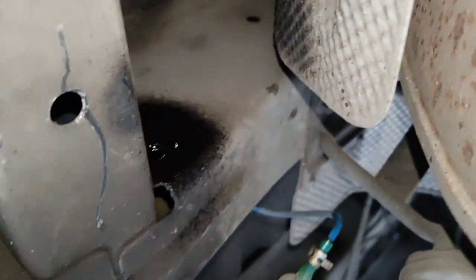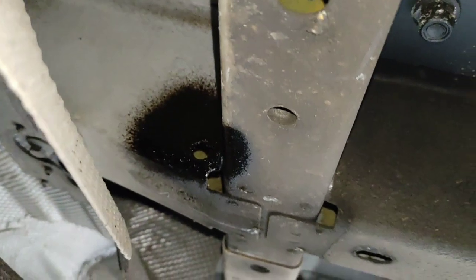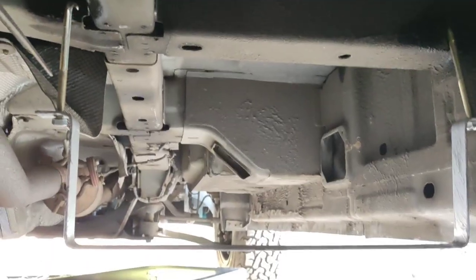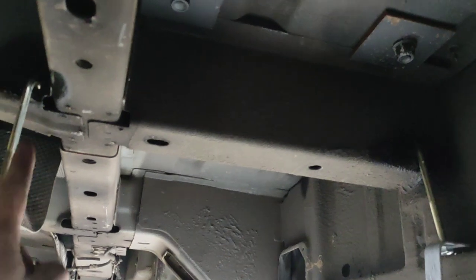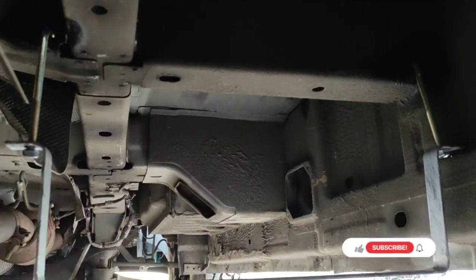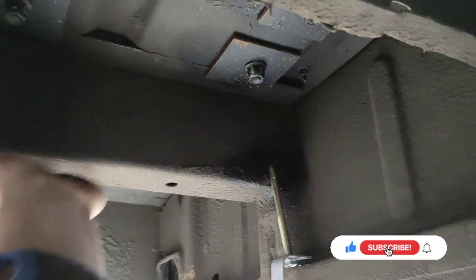Here, hopefully you can see four mounting points which I have drilled and then covered in wax oil. I need to find the J-bolts and I'll show you how they fit. I've mocked up how these bands work — the J-bolts go into the chassis member through the hole, and then the band goes around the bottom of the tank. You just do up these nuts and that'll tighten the tank and pull it up onto the bottom of the chassis rails. We've got two bands to go on it, one here and one here.